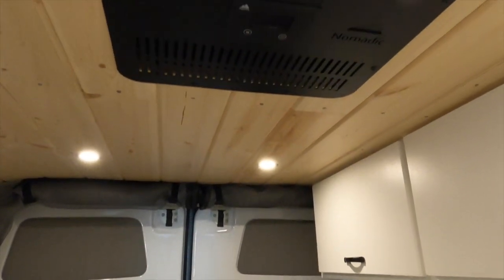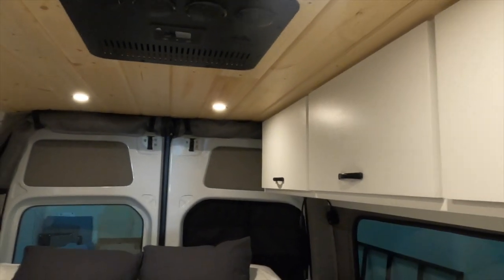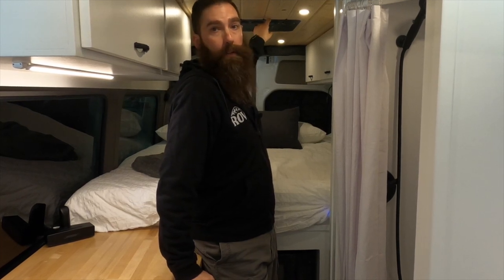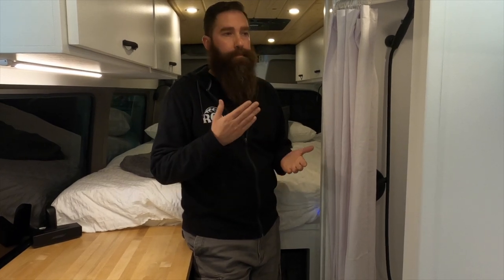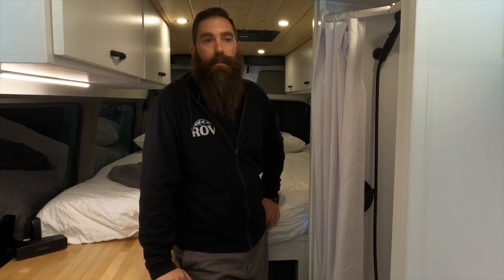What you see there is the Nomadic 12-volt air conditioning system, the 3000. On this size van they recommended the 3000. The nice thing about the Nomadic — two things. One, it's really low profile; some other AC systems take three or four inches of headspace. This one is about an eighth inch plus the vents. The other thing is this is a true 12-volt system — some Dometic and Coleman units require you to run your inverter to run the AC, so you're losing even more power. This one ties directly into our battery system. On high it'll run around 60 to 80 amps; on the eco setting, 30 to 40 amps. On this battery bank it'll last 6 to 8 hours.